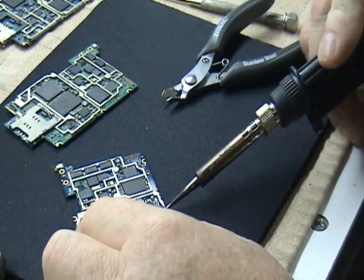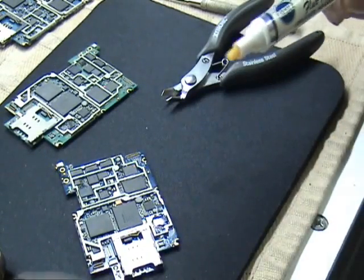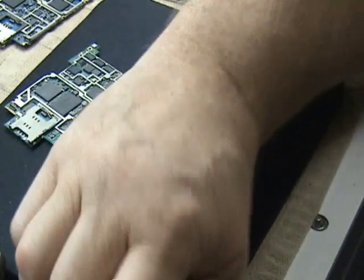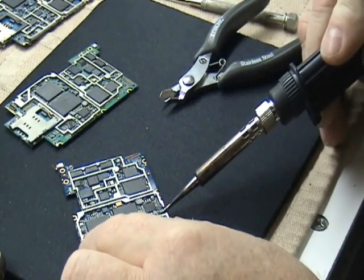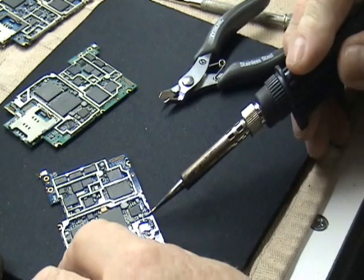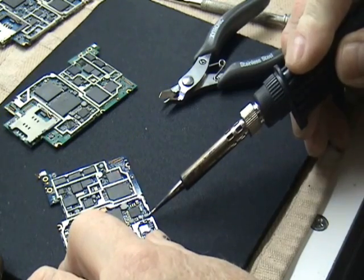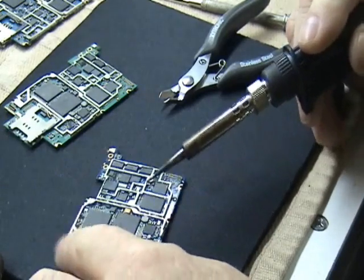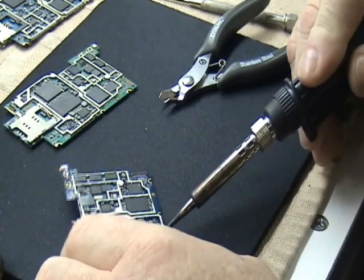I'm going to show you — I actually need a little flux. A little flux pen, just kind of flood it. It's not going to kill it; you're going to clean it up anyway. You can hear it sizzling — sounds like bacon. You've got to be kind of careful too because there are these little copper pads. You can see it kind of lift up there — that's one side — then just kind of push it down, you can see the coil's kind of come apart.